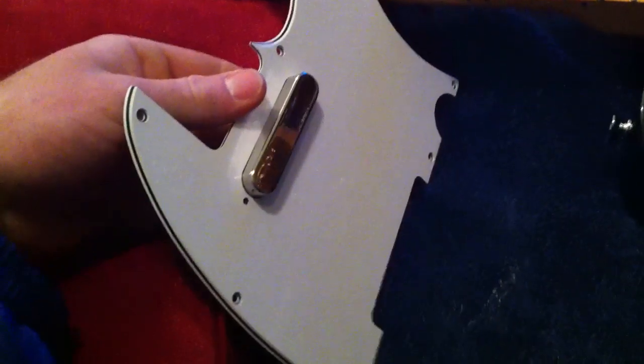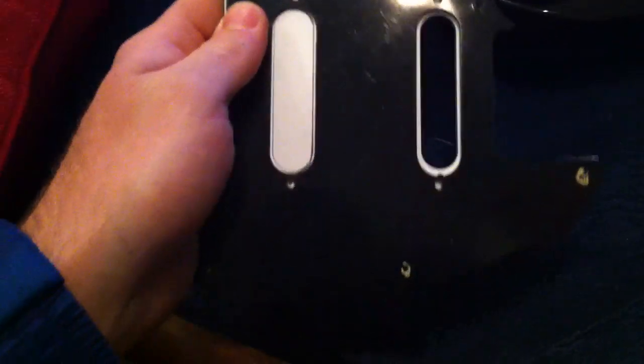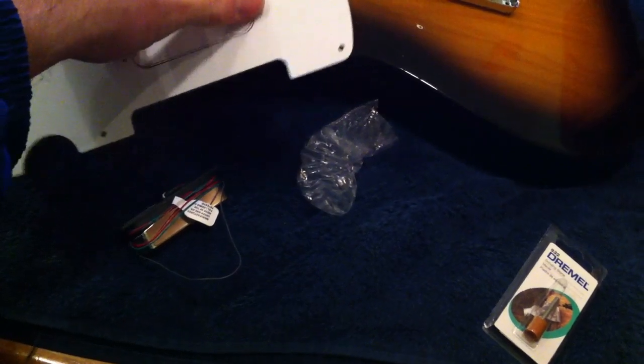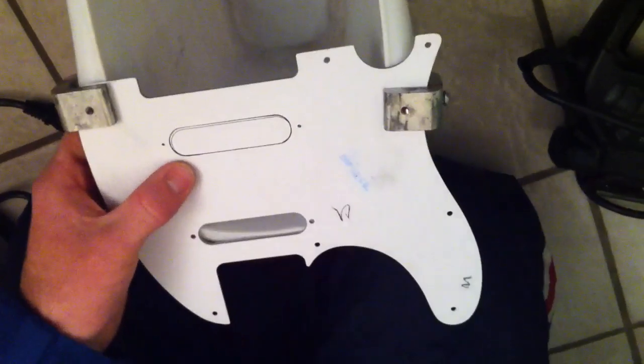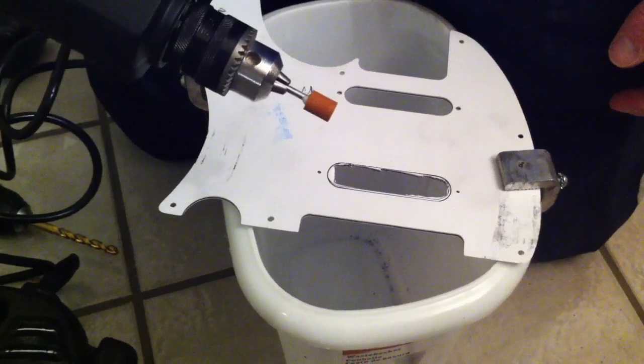It's a nice perfect fit there, but it doesn't have another hole, so I already lined these two up as best I could on the back, took a magic marker and traced the outline. I'm going to cut out the majority of this and then take that grinding stone to make it nice and smooth. I drilled it out in the middle to have a starting point for my blade, and now I've attached a grinding stone to my drill to smooth out these edges.